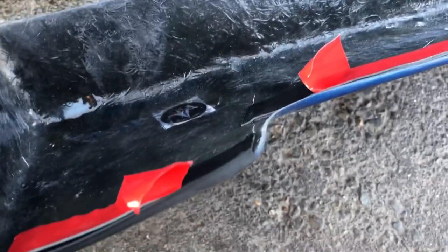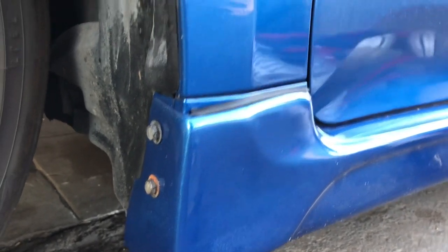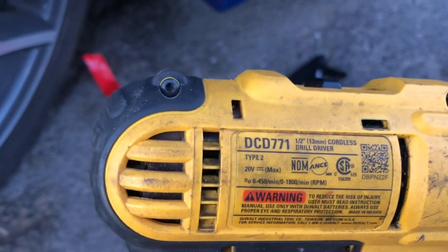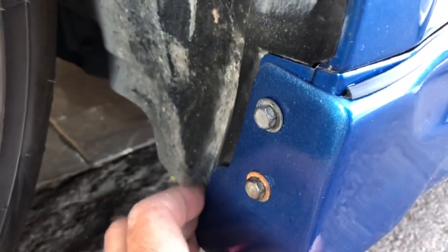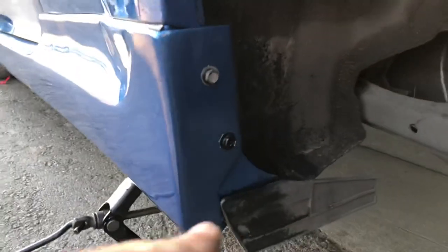Just like that, it's installed. These side skirts aren't 100% perfect - you can see right here it lines up and then it goes down, but that's how the side skirts are made. The general idea: I removed the 10mm bolt right here holding the factory side skirt, drilled the hole with my DCD 771, and I was able to apply two screws. These are automotive body fasteners - the same ones you find in the wheel well. Two should be enough so the side skirt doesn't move left and right. Same deal on the rear - did a hole where the factory one goes and added another hole in the bottom so now the side skirt doesn't move.